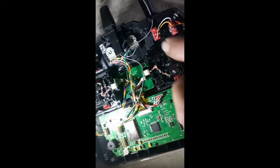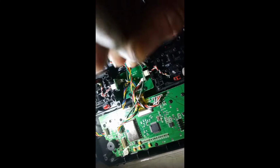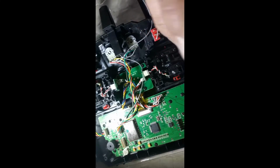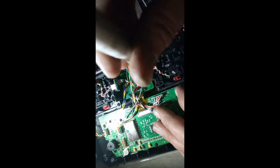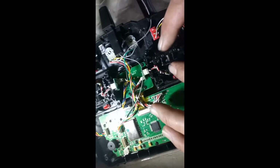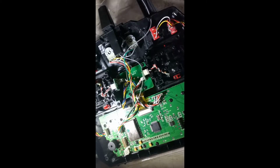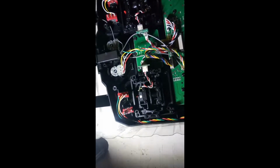Just like that. If it's a little stiff, you can loosen up these 4 bolts here. I think they might give you just a little bit more. They're not smashing plastic on plastic, so it might make it a little easier. Just kind of work it in. Once you got that all said and done, you can go ahead and get this all put back together now.